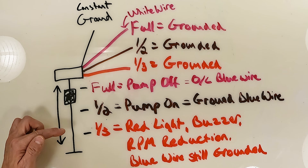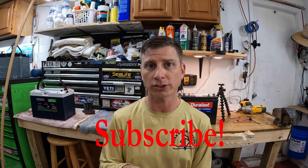That's going to be the main difference between the three-cylinder engines and the four and six-cylinder engines, because you now have that remote oil tank. On the four and six-cylinder, we've added a fourth wire onto the sensor, which is now controlling a transfer pump found on the remote oil tank in the bilge or boat somewhere. That sensor uses the CDI unit or the computer on the engine to tell that pump to turn on or off using the grounds of those wires. There is also going to be a sensor inside that remote oil tank, which handles warning horn systems and lights.